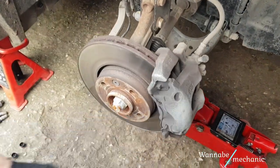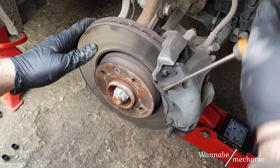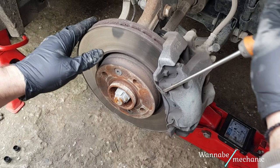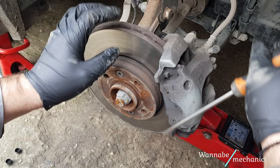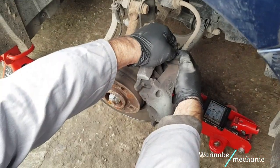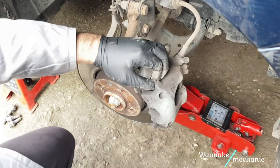Be careful when removing the spring clip — it will slide off with great force, so it would probably be better if you hold it tight with a pair of pliers. Pull the caliper firmly towards you so that the piston retracts a little bit, then you can wiggle it until it slides off.